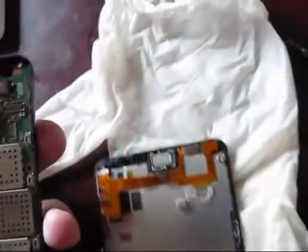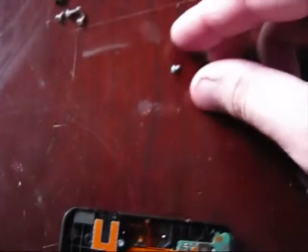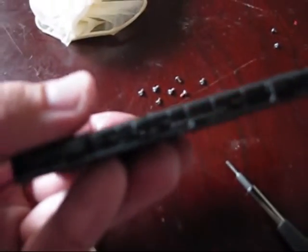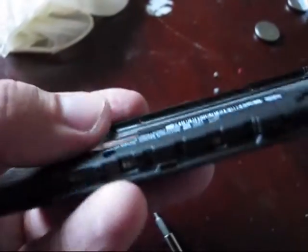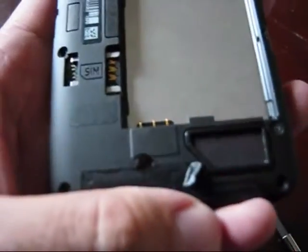I disconnected it again because I forgot to reinstall those two screws located here and here. Reinstall them — they are different sizes. The six of them hold the body to the digitizer, and those two are separate. Reinstall those two bolts, then plug the cables back and reinstall those two small-size T5 screws for the button mountings, which need to be tightened. Then reinstall those seven bolts all the way around, with one of them under the sticker.